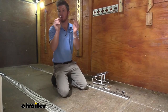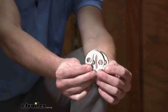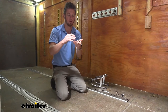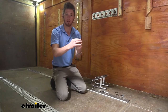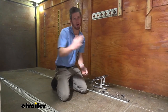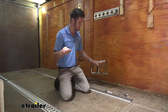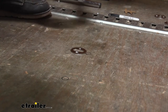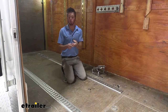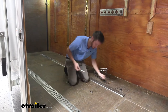We're going to have two different kinds of brackets: one is going to have a flat shape, and the other one's going to be like a little channel that the circle is going to fit through and slide around. Put the bigger one on the bottom — that's just going to act as our spacer. Make sure both of them are facing the right direction, and that the skinnier part is facing forward, so whenever we drive our motorcycle in it's going to push these little studs up and into that channel so it's not going to get loose. Then line these up with that dot right in the middle at the top of the narrowest part of that channel. With them in place, we're going to mark the holes because we're going to do some drilling to get everything installed.